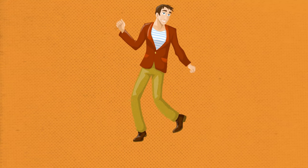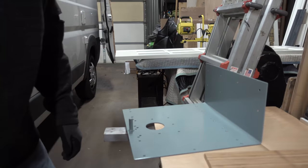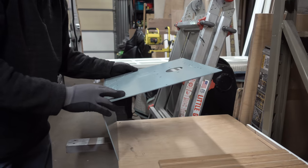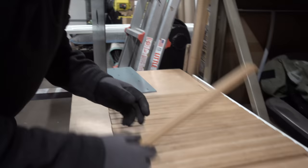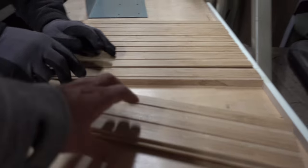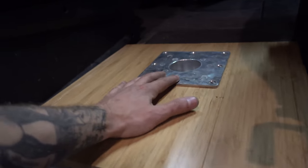What we ended up making was basically an L-piece of 5/16 metal. This provides a separate mounting plate for the base of the dining table so we don't have to mount directly to the frame of the van. The actual flush mount is mounted to bamboo flooring — the same bamboo floor we got for $8 that I'm using throughout the van — joined with tongue and groove and glued down, then mounted to the L-bracket.